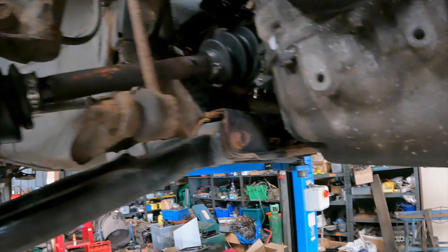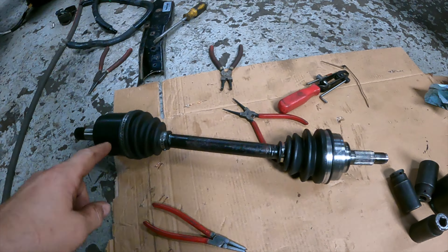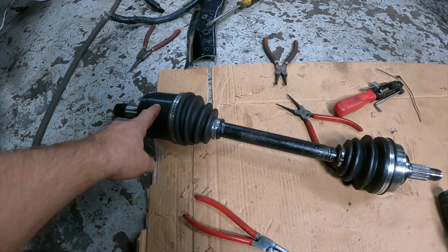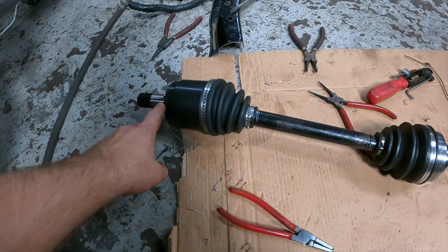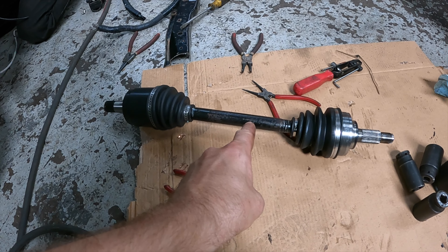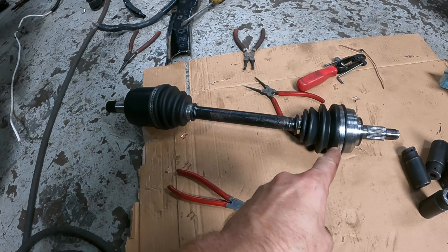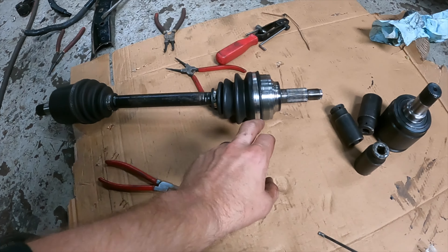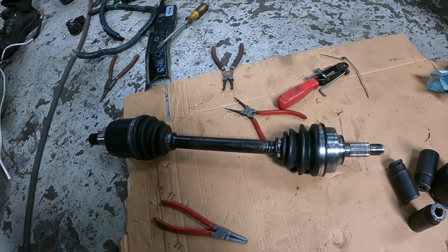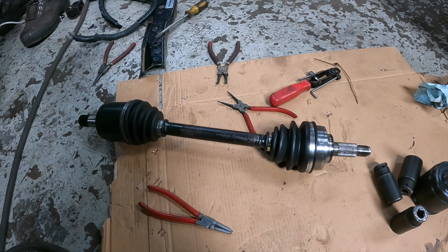Looks a good length — looks ideal. Final drive shaft done after another CV joint turned up because I needed the inside spline part. That's now the split shaft side of the EP3 going onto the passenger side of the Jazz. Full EP3 shafts and CVs, just B-series inners — and that's your conversion shaft done for your Jazz. I'll go and fit that in the car now and then that part's done.